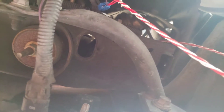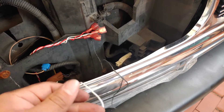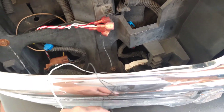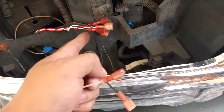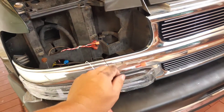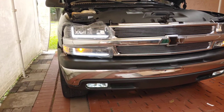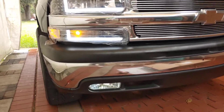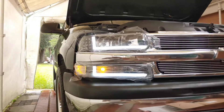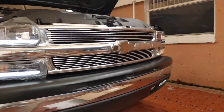Now we're gonna go up to the headlights and connect them. All I gotta do is connect my white wire - which is my positive - to the red one, and the black wire to the white one which is my negative. I'm gonna put in the headlight and install everything on this side and see if it works. You guys can see they are working! They only work whenever my fog lights are turned on, and they're on right now. That's how she looks.